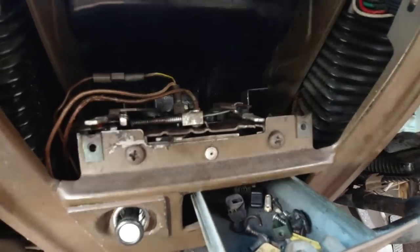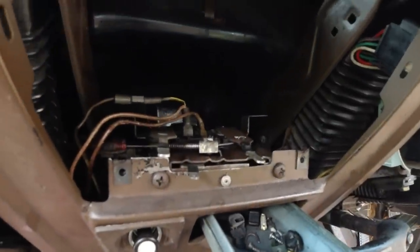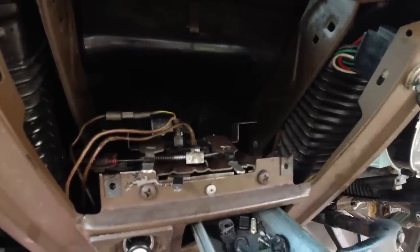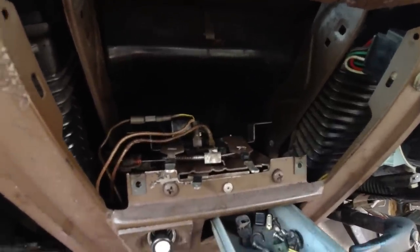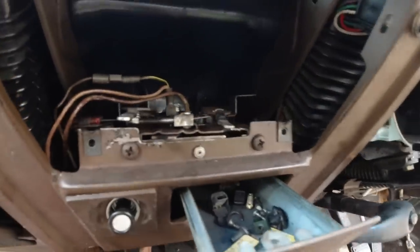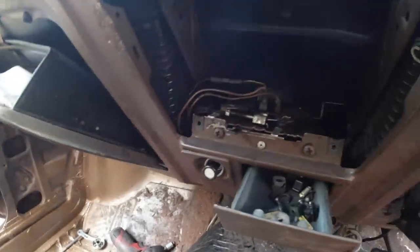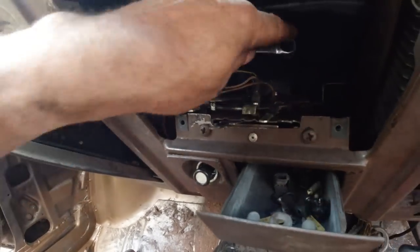It does work. So that's the motor speed. And then the heater control levers there, you can hear it activating. Sounds a bit clunky at the moment, but it has all got lubrication in. So it is working, it's operating the flap in the box, so we know that's right. And I've checked it. When I'm on cold that side, it's fully closed, and when I'm hot this side, it's fully open for the heater matrix. So that's done. So screwing that back up now. That was a mission. That took about 4 hours. It's amazing, isn't it?